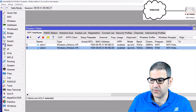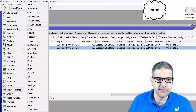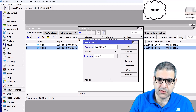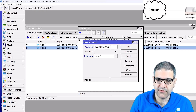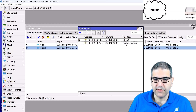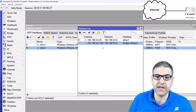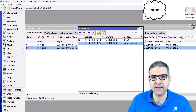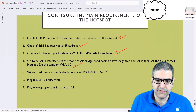So we go now to the bridge, and then go to IP address and put the IP 192.168.30.1 slash 24, and put it on the bridge hotspot interface. It's there now. And later we have to configure the DHCP server from this range, so anyone connected to any of the wireless will get an IP of 192.168.30.something — .2, .3, .4, and so forth. Point number five is done.